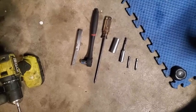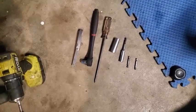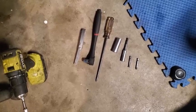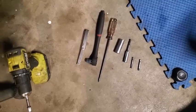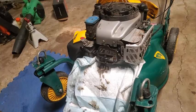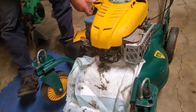For the long screwdriver - that's a Phillips head, kind of blunt so it's not going to gouge anything - I'm going to stick that down in the spark plug hole to determine top dead center and where the valves are in the cycles. To the left of that there's a ratchet wrench with an 11mm socket that fits right on a nut underneath the rocker box cover - there's a nut on each one of the rocker arms, and that's all that's needed to adjust the valves. Then I had a 5-thousandths feeler gauge on the far left. I'll leave a link in the description for the Briggs and Stratton valve clearance specs document.